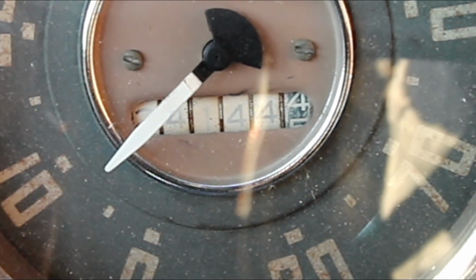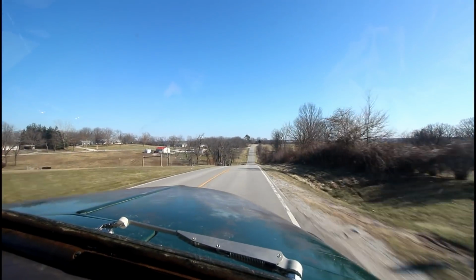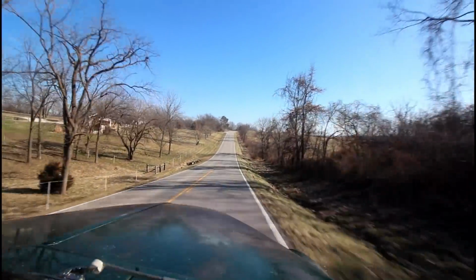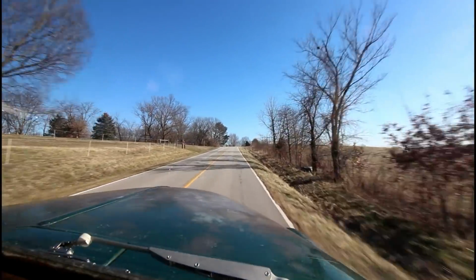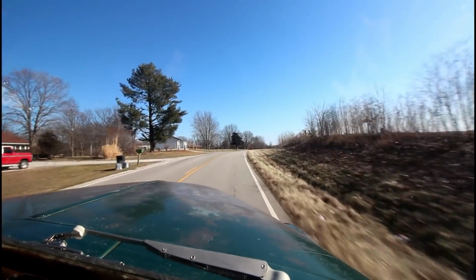The odometer on this thing says 24,144. Whenever we got it, it was about 21,415 if I recall. Since we got this thing, we put some tires on it. We opted to go with bias-ply tires, and being that it's sat for a few weeks and it's super cold out right now, I can definitely tell that the tires have some flat spots in them. They'll go away within the next 5 minutes, I'm sure of it, once they warm up.